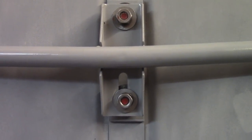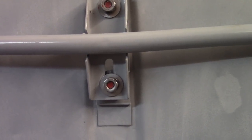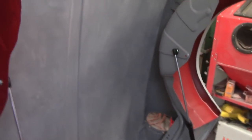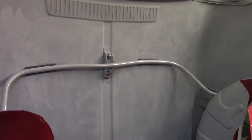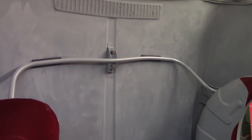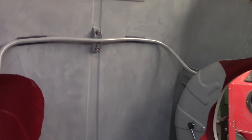I'm going to pop the bonnet up and talk through another idea. This is that center mounting point — and you can see the holes are slightly off to the left a little bit, which tells me this bracket is not centered in the bonnet. The tube end sticks out about a quarter of an inch here and probably pushing a half an inch there. So shooting from the hip — because I don't have any zero reference — I think what I'm going to do is loosen it back up, get that center bracket snugged up, and get it semi-aligned in the center of the bonnet. That way at least I know I have a good idea that I'm going to be pushing on both sides in the same way.